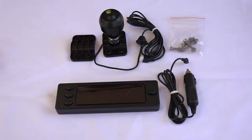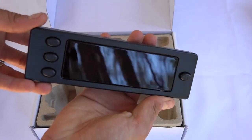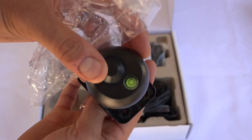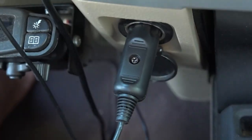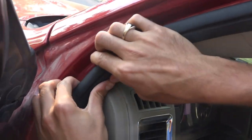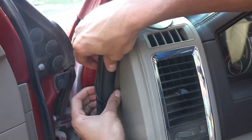Installation I found to be really easy. It basically includes the readout display, a cable that runs up to and including the sonar piece that you mount on your truck, and a power cable that you plug into the standard 12-volt receptacle in your truck. They include a little rubber grommet so you can drill a hole if you want and run the wire through to the outside. We just ran it along the rubber molding in our truck and popped it out around the door and up on top.